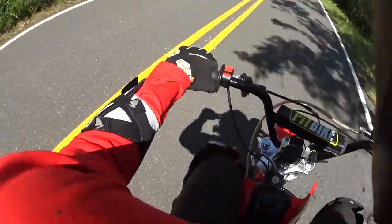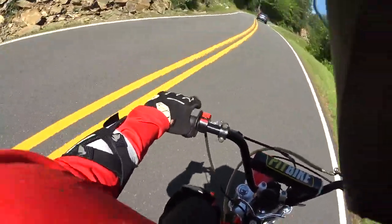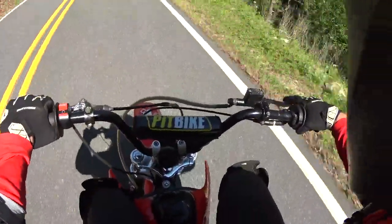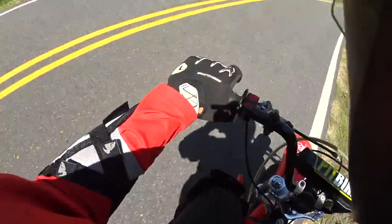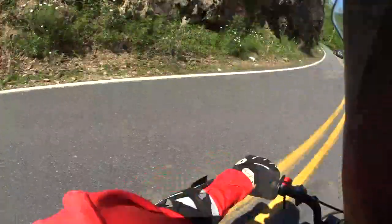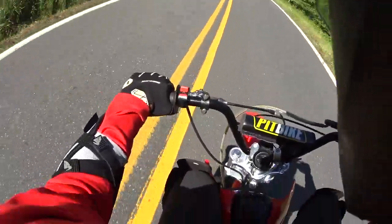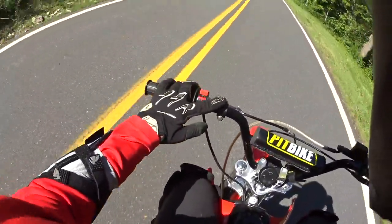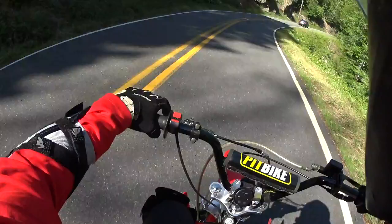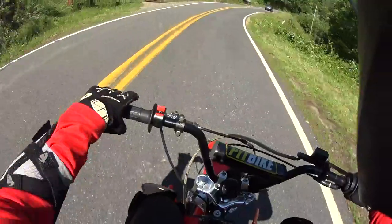And these handlebars make such a difference. Guys, it's really important to do things like get a clutch that fits you. Some of them are really long. Like, see my brake? That's a super long lever compared to my clutch lever. So I have a shorter brake when I just haven't put it on yet. I have to machine it down because it doesn't fit exactly. And another thing to do is unscrew these screws here and move this how you want it. Some people like it further down, like this. Some people like it further up. You might want to move it further right or left.